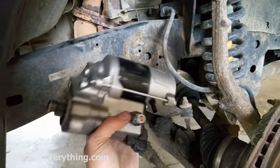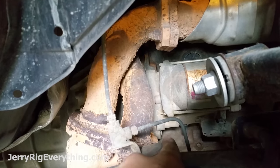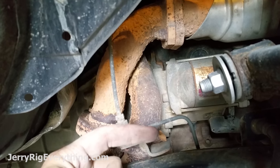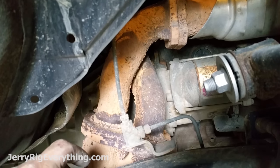If you look at the replacement starter that I just bought, there are only two bolts that hold it in place — one on the bottom and one up at the top as well. When you're looking at it from the inside, that bottom bolt actually comes through the other side and screws into the starter motor, so there's nothing to ratchet off on this side — you just have to take the bolt out from the other end.